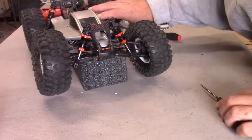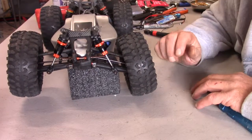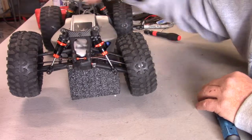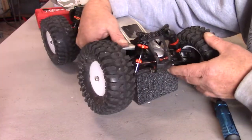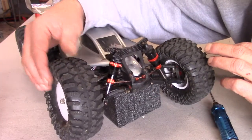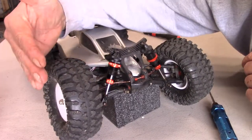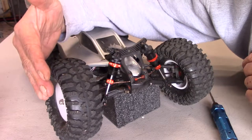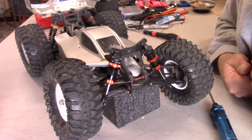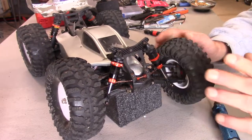As you can see there's a major difference here - the wheel on the left is much lower than the wheel on the right. But now the right is up enough, even at its fully extended position, that I can move this caster out to a more real alignment, and hopefully then the truck will drive a lot better.